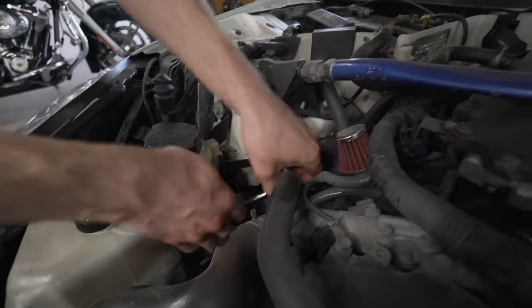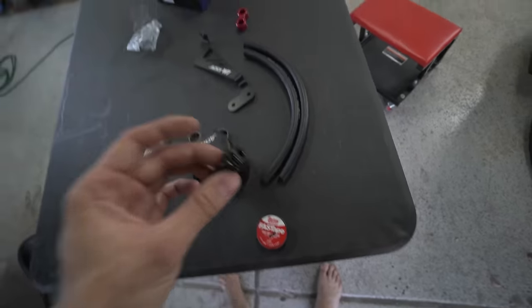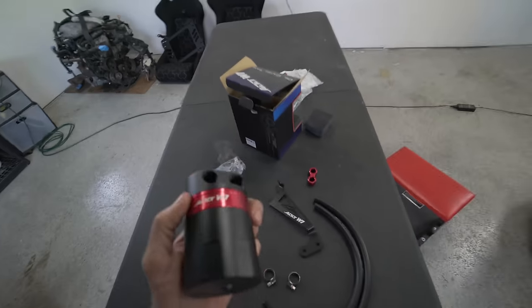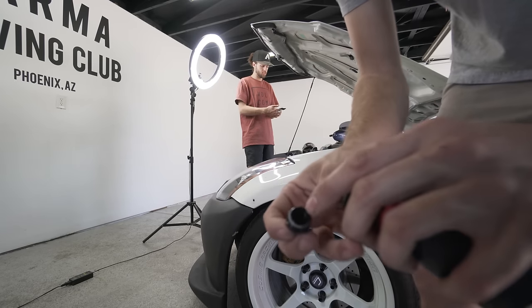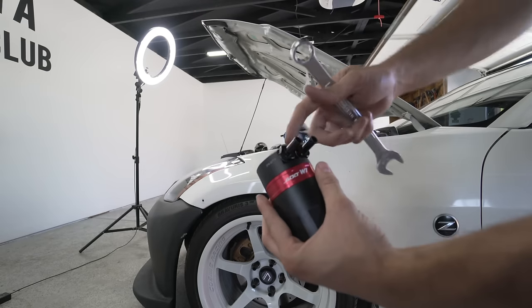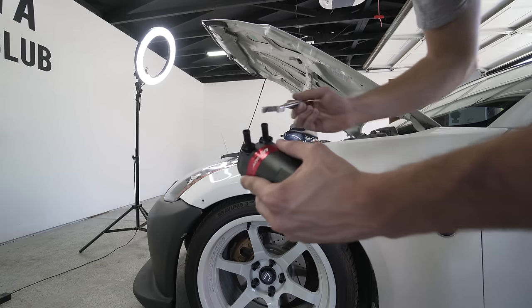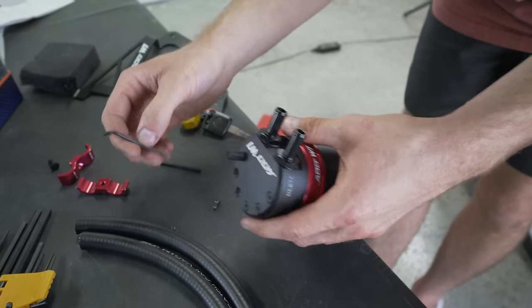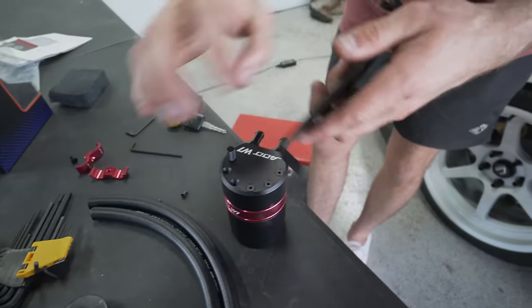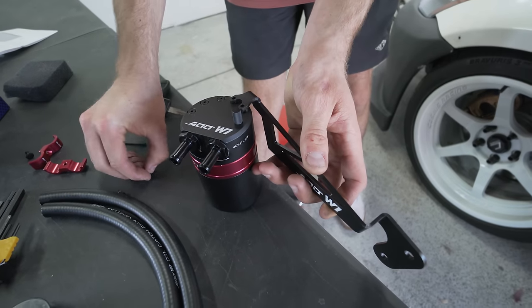While Cam's doing that, I'm going to go ahead and use sealant tape — just tape the threads on the edge — and then those screw straight in. Make sure it's clear; you don't want any sealant tape or anything getting mixed in with your oil. Once you have both in hand-tight, it's a three-quarter-inch wrench to tighten even more. We have our small allen wrench to remove those real quick. The bracket is going to go on the car like this, mount here, and we'll put our bolts back in.